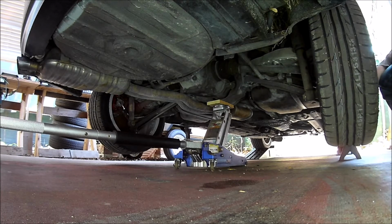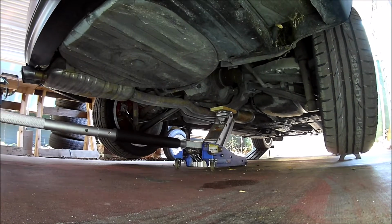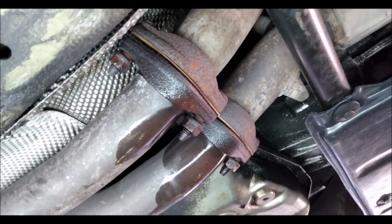If you've seen my recent BMW videos, you already know how to remove the exhaust system. But just in case, I'll show it again. I started with these two reinforcement plates in the middle of the car. One of those plates supports the exhaust, but the other one also needs to come out because it'll be in the way. Next, I'm going to loosen the nuts that attach the exhaust system to the manifolds. There are four nuts, two on each pipe. On my car, they were 15mm.